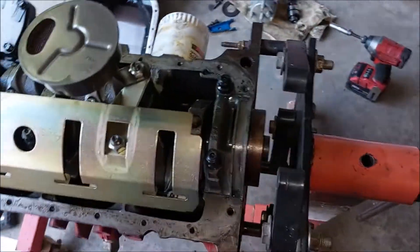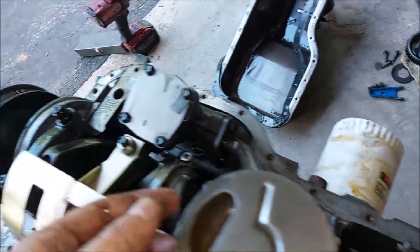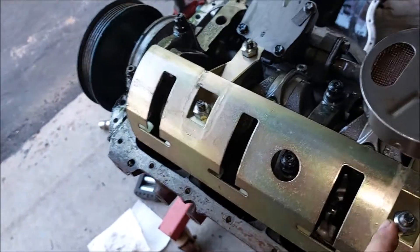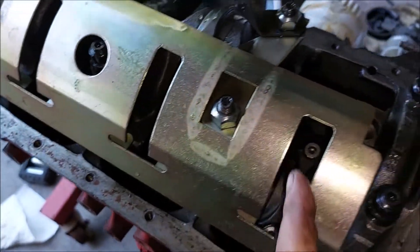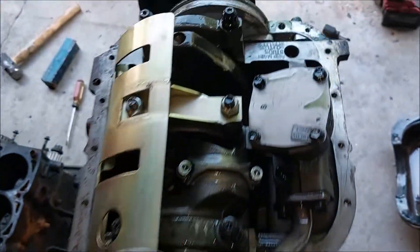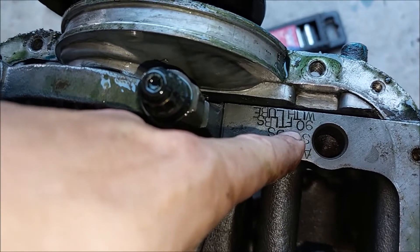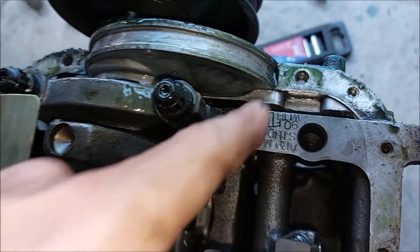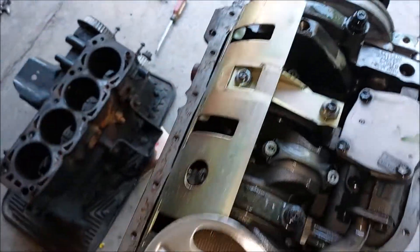What we're doing next is we're going to take the oil pump screen and tube off, then we're going to take the windage tray off and see what happens. These nuts are kind of strange — usually I like the lug nut style. It looks pretty good. Let's see — we got something written here: ARP main studs, torqued to 90 foot-pounds. So somebody installed these studs — pretty neat. Let me get these nuts loose and get this off.